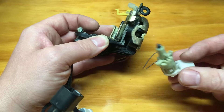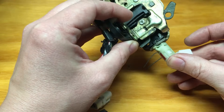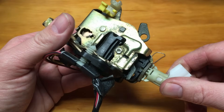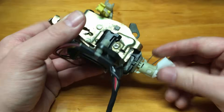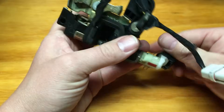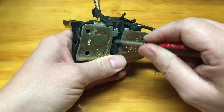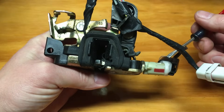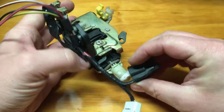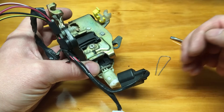The mechanism inside is generally fine. Going back in with a new one, you simply insert it like this — fully seated — then turn it counterclockwise and you'll see it lift that tab and lock in right there. At that point you can clip the connector in, and you can manually lock and unlock your door latch. It should now respond, your dome lamp will come on, and the chime in the cluster will sound.